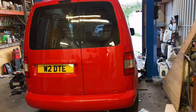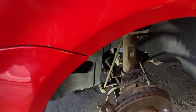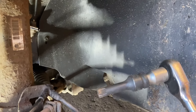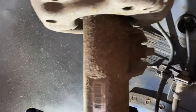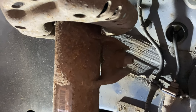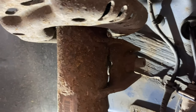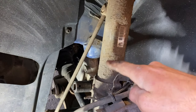Let's get the wheels off and see what's going on. Looking at the front end: pinch bolt on the shock absorber, we've got an 18mm nut and then a 14mm multi-spline bit for the other side - it is a big spline bit. Also need to get the drop link off - 18 or 19mm. Little tip with drop links: clean the end of that thread with a wire wheel or wire brush, grease it right up, then there is a 5mm hex bit in the middle. Try and get the thread as clean as possible because drop links can be a pain. Get your nut and bolt out the way, get your drop link out the way, then we need to separate the hub from the shock.